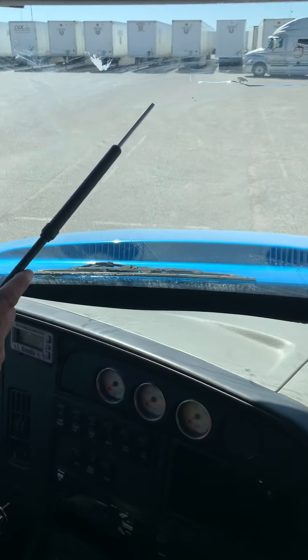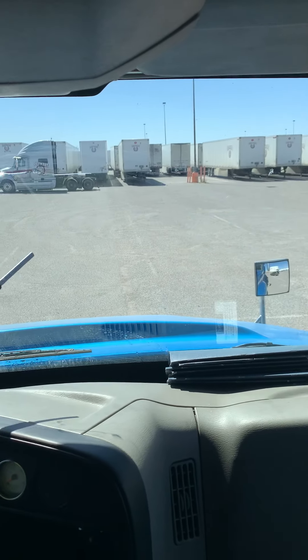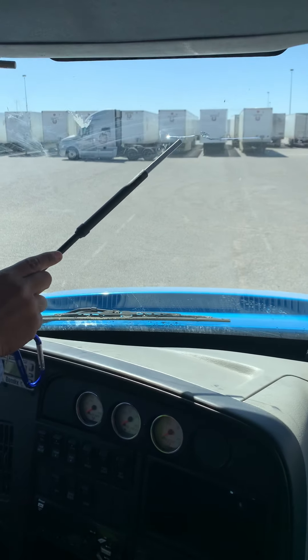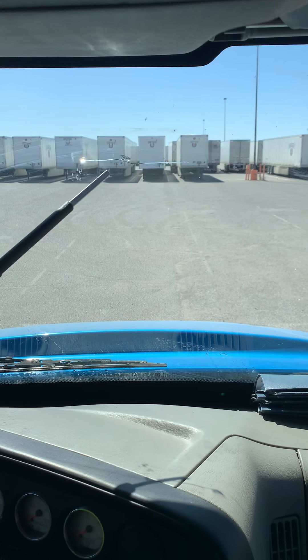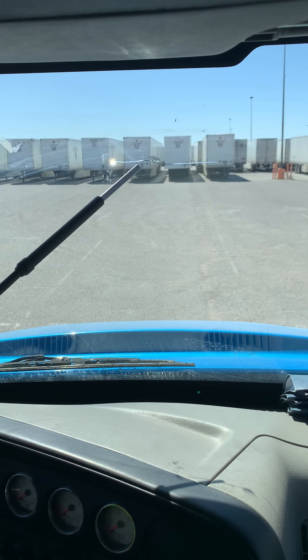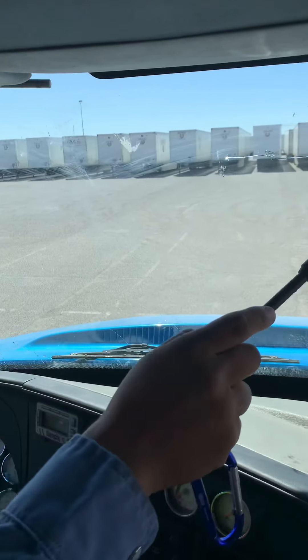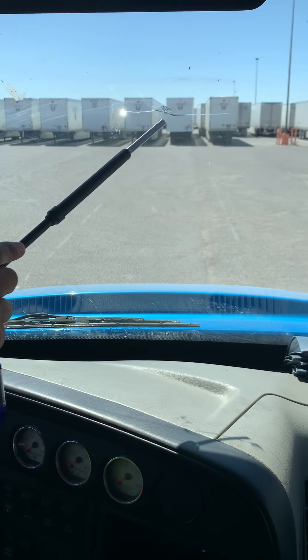From here I'm gonna check my windshield. The windshield is properly mounted and secure. There should be no cracks bigger than three inches — like this one here, this windshield needs to be replaced. Make sure there are no cracks bigger than three inches, no intersecting cracks, and no signs of leakage on the roof. This windshield needs to be replaced.